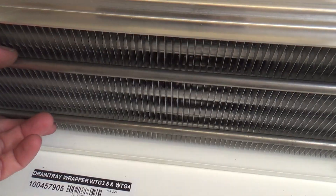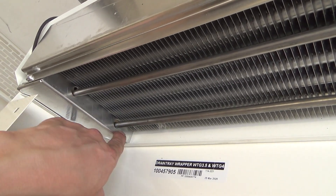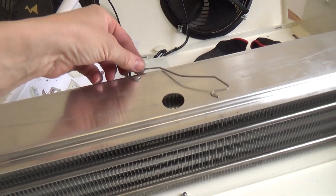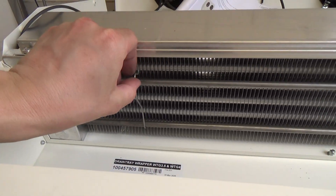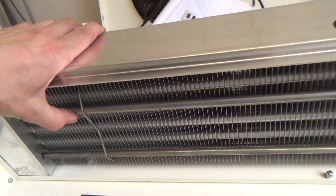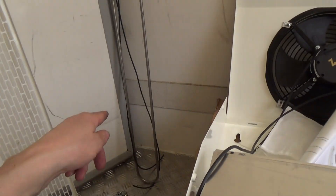It's got one heater that goes by the coil — that one there — and you feed the two wires through holes at either end. We're going this end because the expansion valve's got to go down there. Feed your wires through and then you get these little clips that hook in under one of the coil pipes and then hop over there just to hold it in place.